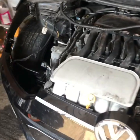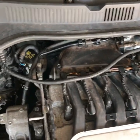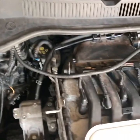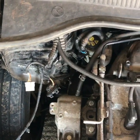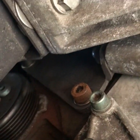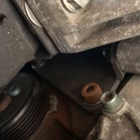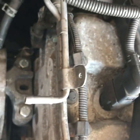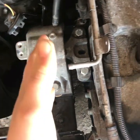Let me give a run through on what exactly we've had to do up to this point. When my main man Zach and Adrian and Goose came down over September, we managed to smash out getting the engine mounted. All that a long time ago. What we basically had to do was cut out and make a bit of angle, weld it onto the chassis rails to get rid of all the rest of the stuff, and then custom make our own mount. Luckily I work at a fabrication company, and we managed to smash that out on the CNC plasma cutter and water jet machine. Cut that all out and got it all bent up, and that's how it's mounted on that side, purely because we just don't have the room.